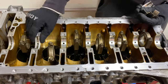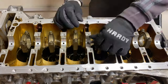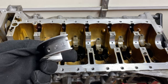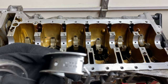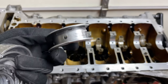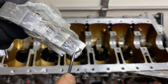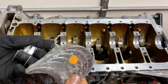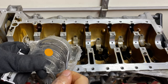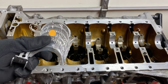Back at the engine, I removed all of the old crankshaft bearings, cleaned the area with some Scotchbrite, and removed the residue with brake cleaner and a lint-free paper towel. We are now ready to install the new stuff. Since I'm going with aftermarket bearings, you definitely want to make sure they are standard size — indicated by STD on the bearing. All of them should have it. Otherwise you might get an oversized one. They do make 0.025 oversized bearings, and you definitely don't want those unless you've had your crankshaft resurfaced.